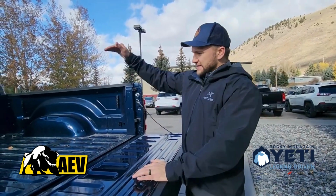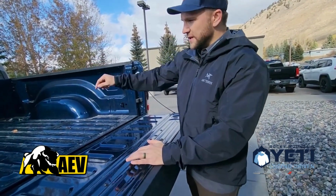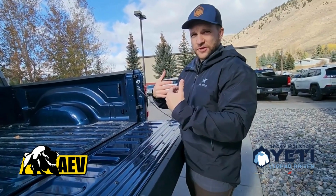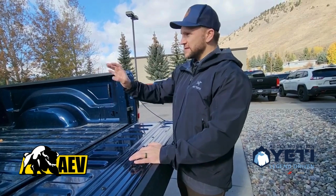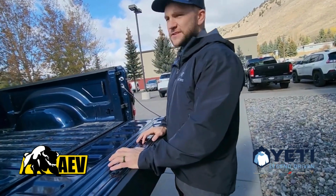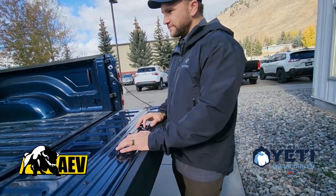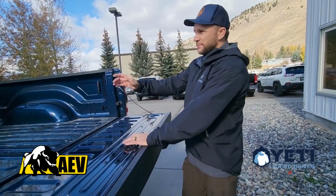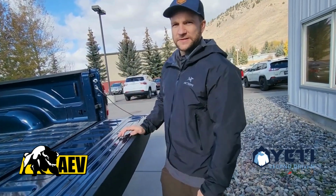The second option is a flat mount. So we get rid of the tire carrier. The tire lays flat in the bed. We put 4 holes in the bed, and we ratchet strap it down to the bed. The benefit to that is all of that is removable, so you can use your bed. This one, if you take the tire out, you still have the vertical tire mount, which can kind of be in the way, but this just looks significantly better, and it's easier to get the tire off. You're also moving more weight further back in the truck. Yeah, over the axle, so that could improve handling, I would think. If it was hundreds of pounds, but that versus a foot further back with 150 pounds, you probably wouldn't even notice the difference. Yeah. It does affect visibility, obviously.